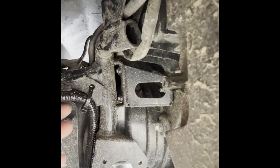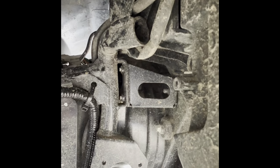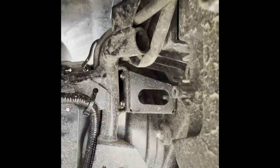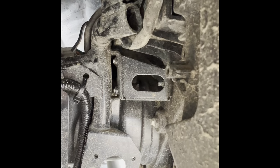And then, these wires underneath the connector on the left side, there's a burgundy wire. That's a power wire when your lights are on. So what I did is I tapped into there with another wire, and I got a ground right off of this bolt, 10 millimeter bolt. I ran a ground wire from there, and then I ran it down to my license plate, and it gave me a license plate light. And that's how I did it.